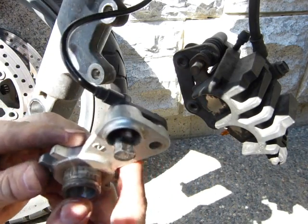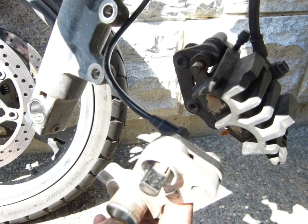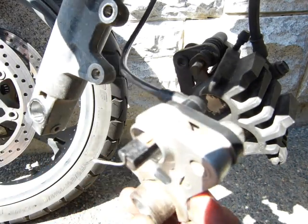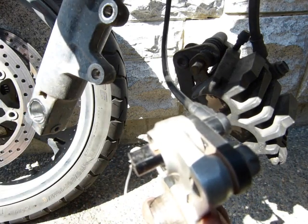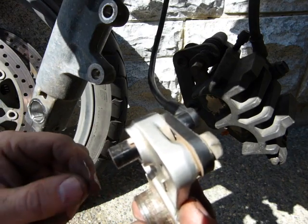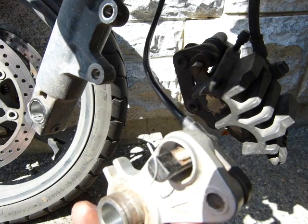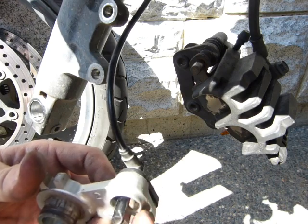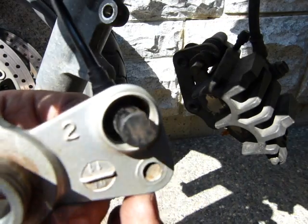On the ABS sensor you will find another piece of magnet — this one here. I can show you it's a piece of magnet. When you clean these, they will pick up magnetic debris. Rust is also magnetic, so metal lost due to rusting leaking from the ball bearing was picked up by this magnet. It needed a really good cleanup — it's just a stick of magnet.